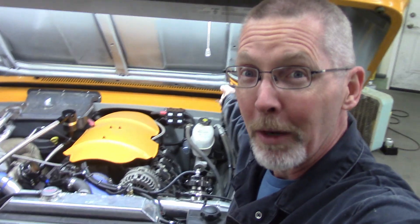You don't have to believe me — I can be boisterous and volatile and then I get banned from forums. The PCV system — the positive crankcase ventilation system — is good for your engine, and under full throttle it shuts off. So it doesn't even hurt you. Everything to gain. If you're worried about carbon all over your intake system, it's because your rings are shot. Fix the motor and it works fine. So this should work okay — I'm going to give it a go and see how that works. I did find out in servicing this that my one-way check valve back there was missing the spring, so it wasn't stopping stuff from going into the crankcase — that's probably why I got a lot of oil out of there. I have a new one with a new spring and we'll see if that works. Curious to see how that oil separator works for me.